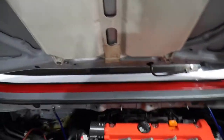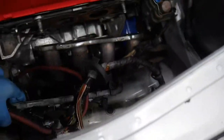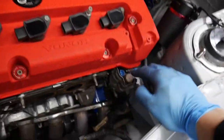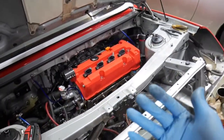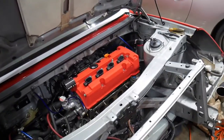Just a little update — it's been around an hour here. I got most of the harness out from the firewall, it's all over here now. I removed all the coil pack ones, all the ones for the resistor sensors, all the ones on the side of the block, as well as all the injector ones. The only part of the harness left is the back side — it's clipped to the back of the block and that's the only one I haven't got off. So I need to jack up the car pretty high, go underneath, and take it off the back of the block.